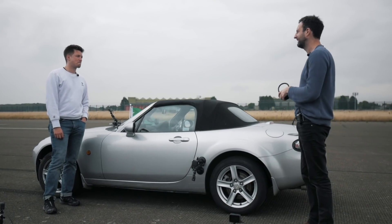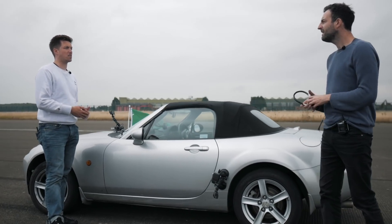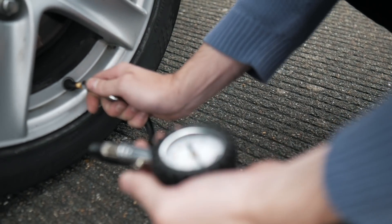What do you think we should go down to? We're at 70 now, we need to make a good chunk I think. I think 50. I can see this making a big difference to the size of the contact patch, so we'll see what that does in terms of grip off the start. We're actually off the chart — too much pressure. So much to let out.